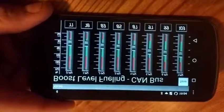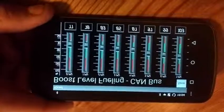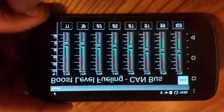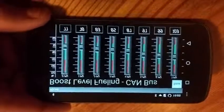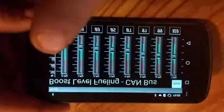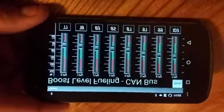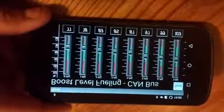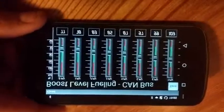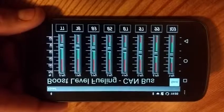All the other tuners on the market up until this point have all been above OEM tuning, so they didn't have the ability to pull power down low. Now, it's not actually going to be slower than stock by going below power because you have bigger injectors in this situation to make up for that. With my 7x9 injectors, my starting point's about 88%. I know guys running 7x13s are starting about 72 to 75%. This is going to give you a very drivable truck off idle. You're not going to smoke out the intersections, but you'll be able to ramp up fueling rather quickly.